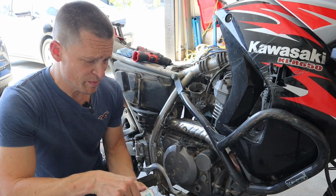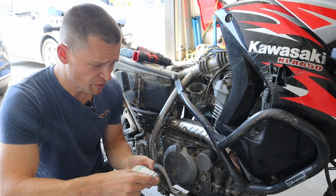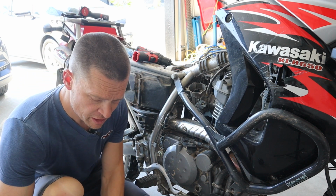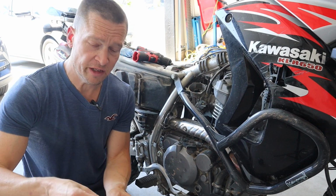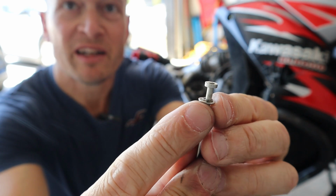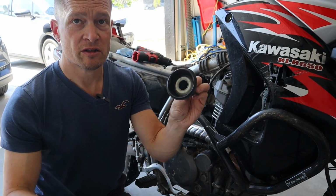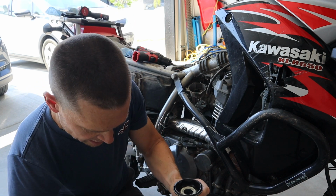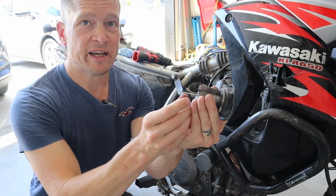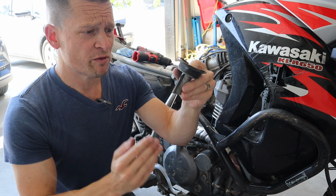Okay, I just got back from the hardware store, picked up some number 6 washers. According to the internet, number 4 washers is what you want, but this is as small as it got. Seems to fit pretty good. If you look at what I'm doing, you can see here I've got this small washer that was laying beside on top, and then I've got this other one beside it. It seems to fit nice and tight. So what you do is you take your slide, you drop that down into place, and then this is the holder that the spring pushes down on. And when I push down on that needle hanging out the side, it's nice and tight. It doesn't jiggle up and down or anything. So I've raised the needle up.